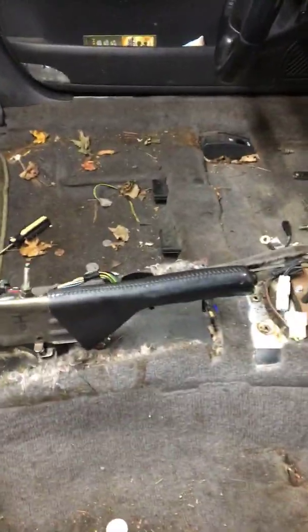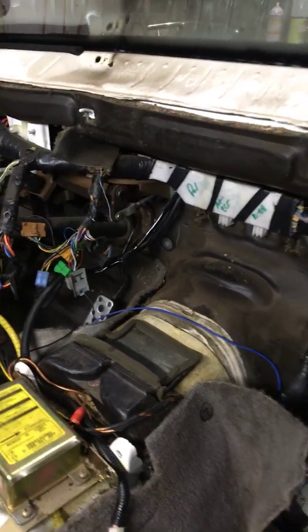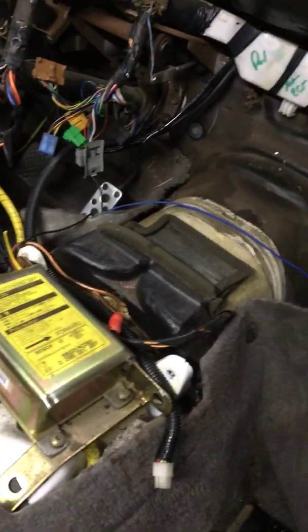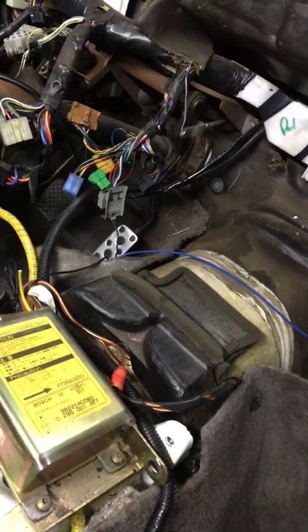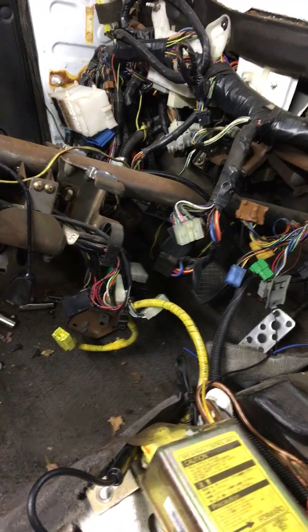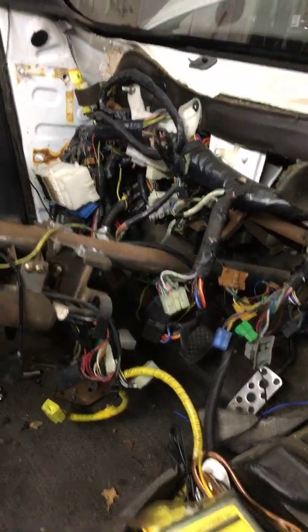Well, really, remove the seats, 4 bolts, remove the center console, right? The cup holder, the heater vents, then the heater control, radio, ashtray, blah blah blah. Get to every plug behind it that you can. Disconnect them, with the piece held in your left hand, right hand on the plug. These Subaru plugs are pretty simple. Just stare at them until you figure out what moves, move it, and put a little tension and pop. So next thing you're gonna do is speedometer, the bezel, then the speedo.